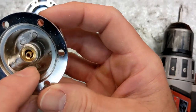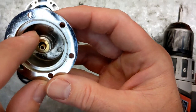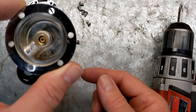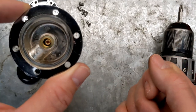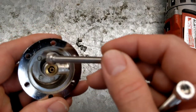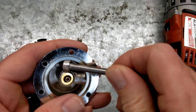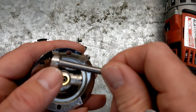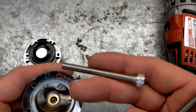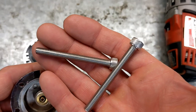So I can drill 2 holes offset and tap them and create a mount so I can bolt this thing down, and that is what I'm going to do. And if it fails, I'll buy another one. It comes as no shock to me or anyone who watches my channel. I have some stuff in stock, but it is too big. So what I'm going to do, I think, is just lay down these heads so that they will fit in here. The other side fits fine. And, of course, I'll have to shorten them up because they're 60 millimeters long. So I don't really need them to be that long.